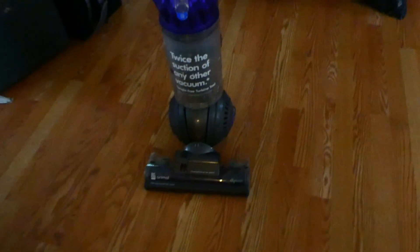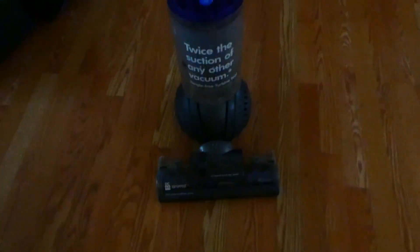I have a pretty good diagnosis on what is causing this. Most likely it's because the part on here is broken off — fun fact, I'll use the new part to show you guys. As you can see, the brush roll isn't actually attached together; when you put it on the vacuum cleaner it's attached separately. Most likely the piece on one side that keeps the brush roll together is broken off, so you need to replace it, and it's actually very easy.